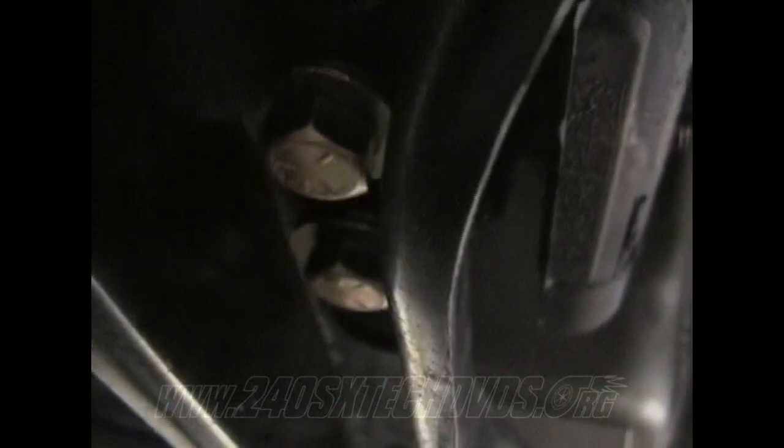And as far as putting your 5-speed transmission mount in, you got the two bolts on the outside on each side, so you got four of them all in all. You have the two in the middle that go to the mount itself, and then you have the two up in the holes that go through the transmission mount to the transmission. That's what those are for. You need to tighten all those down, torque them down.